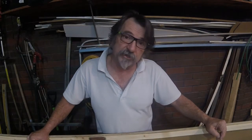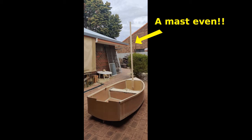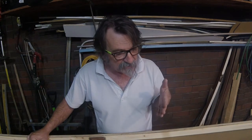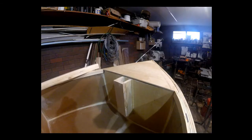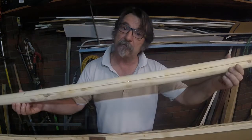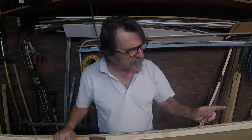Hello, it's Andrew again and welcome to the internet and the Bluefish boat build. Those who have been following from the beginning will be aware that the boat is actually getting fairly close to finished, although these videos are probably five to six weeks old. You can see there's two seats, rollick holders, the bow nearly has a forward bit, there's a mast gate, and I've even made a mast out of some two-dollar pine — exactly the wrong wood for the job, but I think I made it work. Today I'm going to talk about how I did the fitting out: the hull, the gunnels, and the seats.